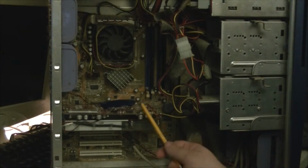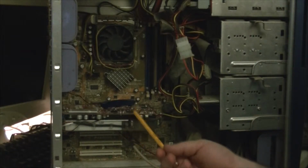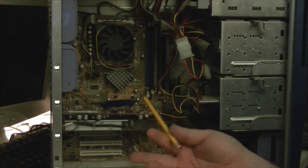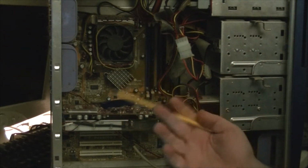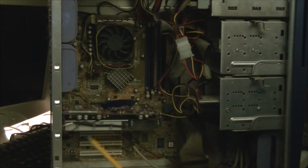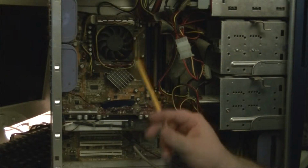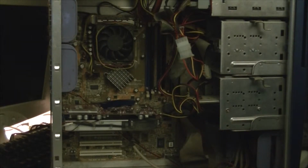Upgrading your system, let's say with this one, which has a Radeon 9700. Let's say you have your power supply up top, like I've mentioned. We'll assume it is a 450 watt power supply. And we have this new beast. I swap it out with, say, a 7800 GS, and I put in a 3.4 gigahertz Gallatin Pentium 4 Extreme Edition, 2 or 3 hard drives, but I don't pay attention to the power supply up top.